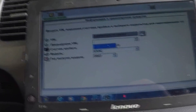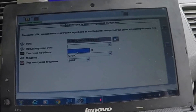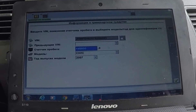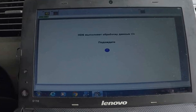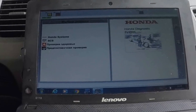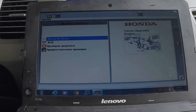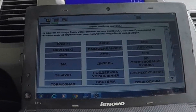Select the Start New Vehicle Diagnosis button on the right side of the screen to add the vehicle. Check that the vehicle identification number is correct, enter the mileage, and click OK. Wait until the connection is established. Select Honda Systems, then PGM-FI.